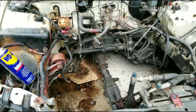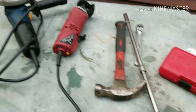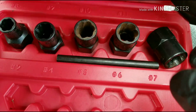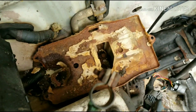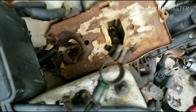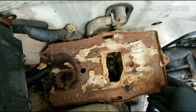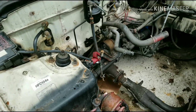The motor is finally out. I had a rusted bolt removal kit — a Craftsman — and this one bites into the bolts to remove them. I needed a whole lot of that. I found the right size socket, a number six, slid it over there and broke them loose, because they weren't coming out with regular sockets. Got this all the way out.